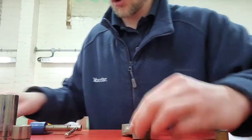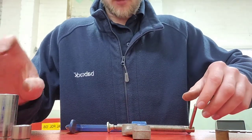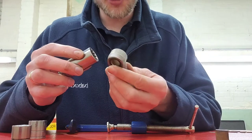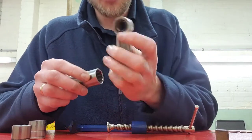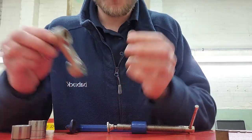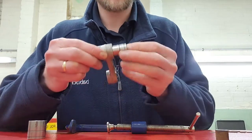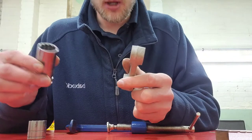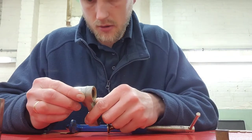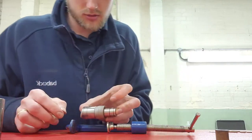To get this out, open up the G-clamp. The reason I'm using a shallow one is because if you've got a bigger G-clamp you might be able to use it straight away. All we're doing is going to push it this way - the seal will come out into the socket with it. So that's going on one side, and then this one goes against the bearing, and the G-clamp pushes the bearing into the socket. Because the G-clamp I'm using is not quite big enough, I'm going to have to start with this one and then swap them over halfway.